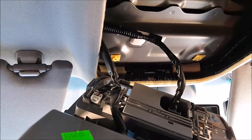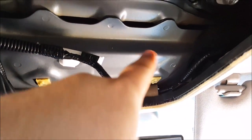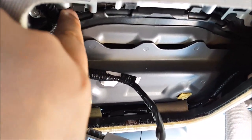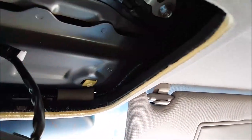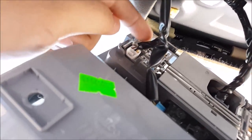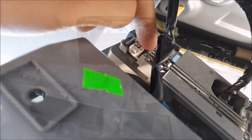Now, the areas where I would put the foam tape — as you can see, there's a wire harness with foam tape touching the metal part right here. I'd probably wrap this part in foam tape, and any other wires here that can rattle against the metal piece in back. Those are all the places I would try adding foam tape.